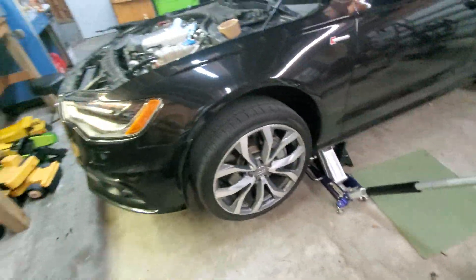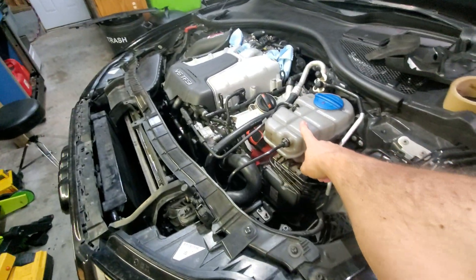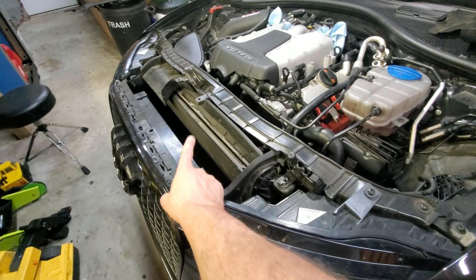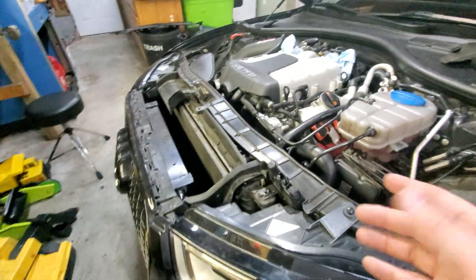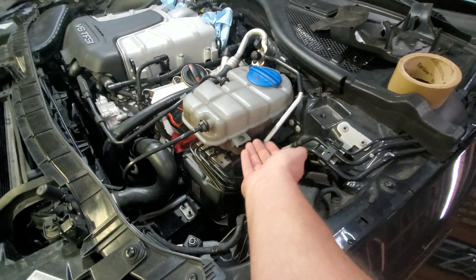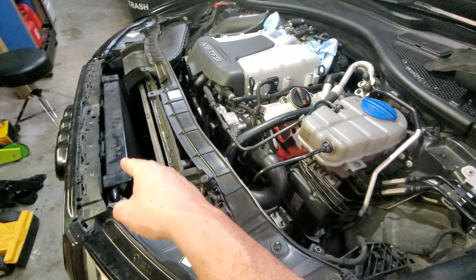If you can see, I've got my driver's side lifted up. What that does is get my reservoir just high enough to get it above my heat exchanger — you can see the height difference there. If you need to, you can even undo this screw, undo this clip, and pull it up about another two inches. You can put something underneath there, but you're using gravity to make sure the reservoir is above the heat exchanger.